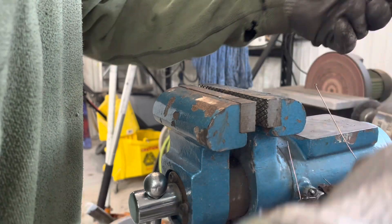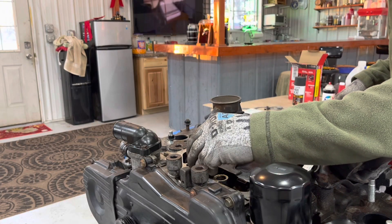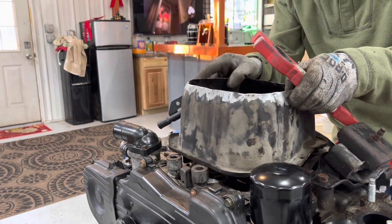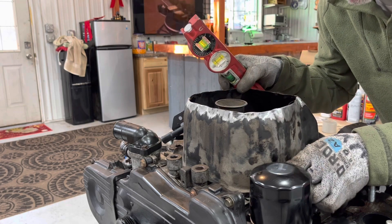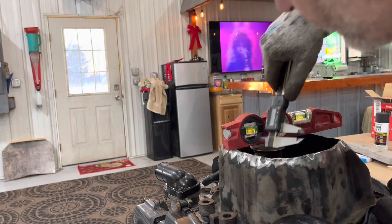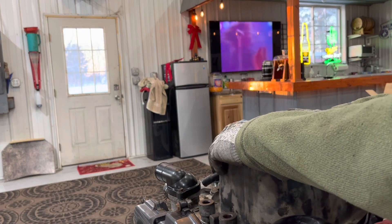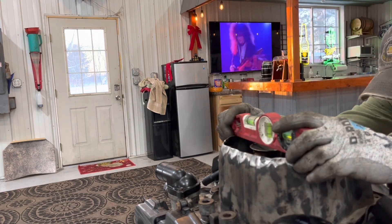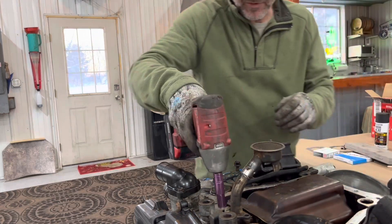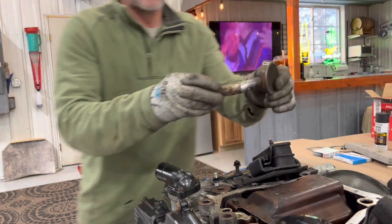I can trial fit that now. I don't have an O-ring in it yet. I'm kind of glad I didn't weld everything together yet — line up the bolt holes, it's magnetic here so I better be careful. I can measure that — 303 thousandths. That's pretty close, flat at 300. That's 5-sixteenths, might be a bit tight, but I'm not afraid of it. I'm going to go with that, I'm going to weld it. There's going to be a gallon of oil in here — it better be picking up off the bottom with a 300-thousandths gap.